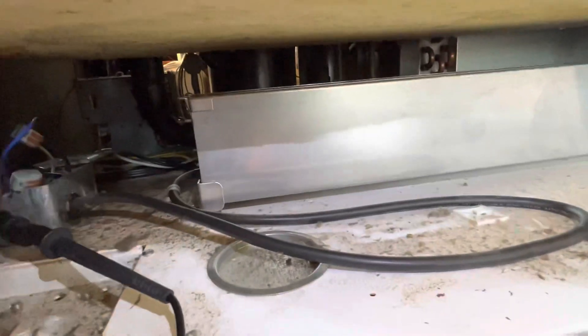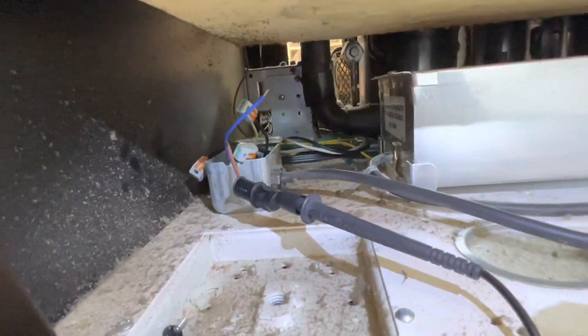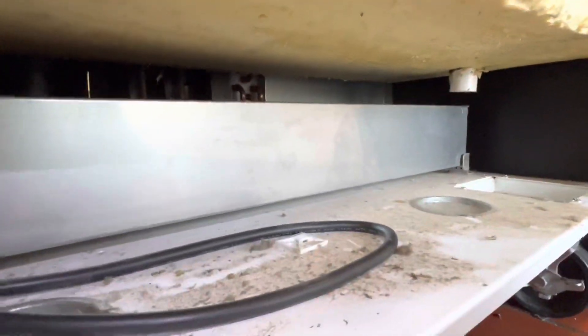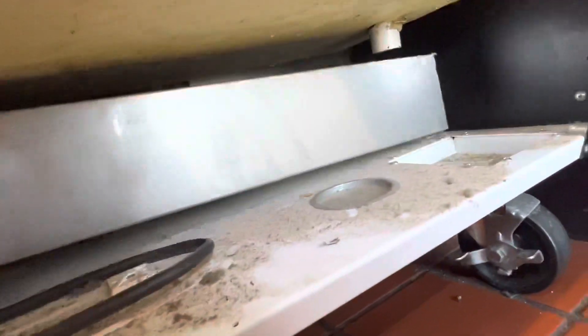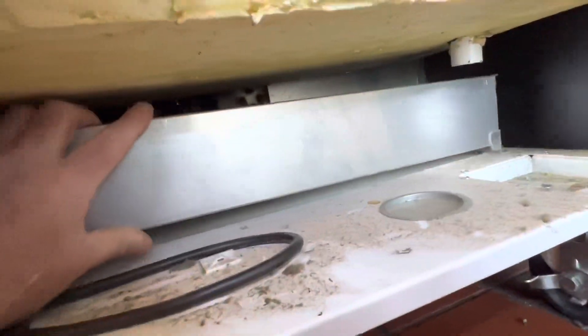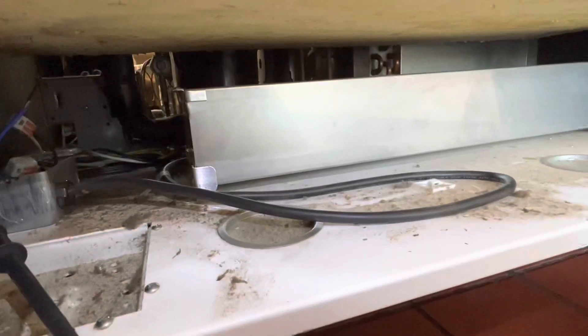These condensate pans always — just come in here, disconnect the wires — first place you look. They can run it, just leave the condensate heater disconnected. Everyday they're just gonna have to suck the water out of the pan. You can just lift the pan up out like that — there you go. Just dump the pan every morning, probably twice a day maybe, depending on humidity. Dump it every morning and evening.